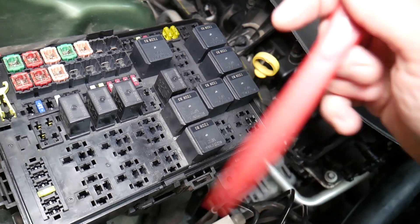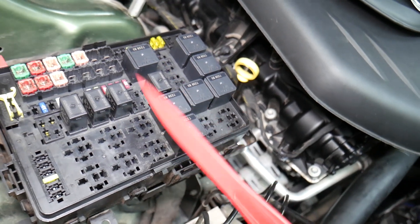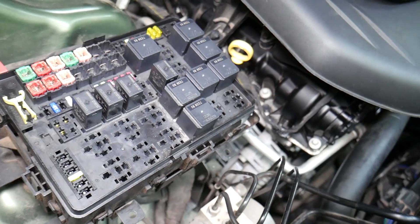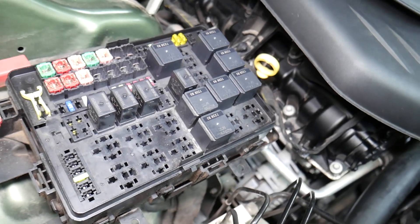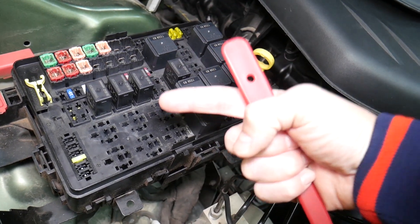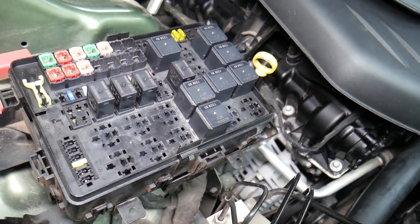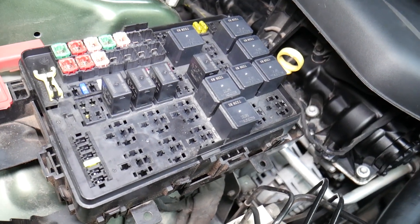For certain fuses, it's important to disconnect the car battery when removing them, otherwise you can burn the electronics. For instance, when working on airbag fuses or anything like that, you need to wait at least one hour after disconnecting the car battery. And if you're not qualified and certified to work on the airbag system, I would never recommend doing that. Also, a common mistake people make when disconnecting and reconnecting the car battery is doing it in the wrong order — you can burn electronics modules. We know because we burned a traction control module on a BMW that cost two thousand dollars. We'll put a link in the description below on which battery terminal to disconnect first.